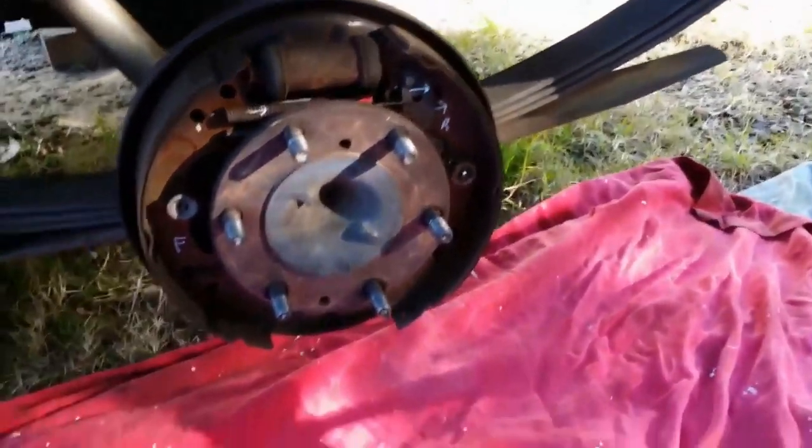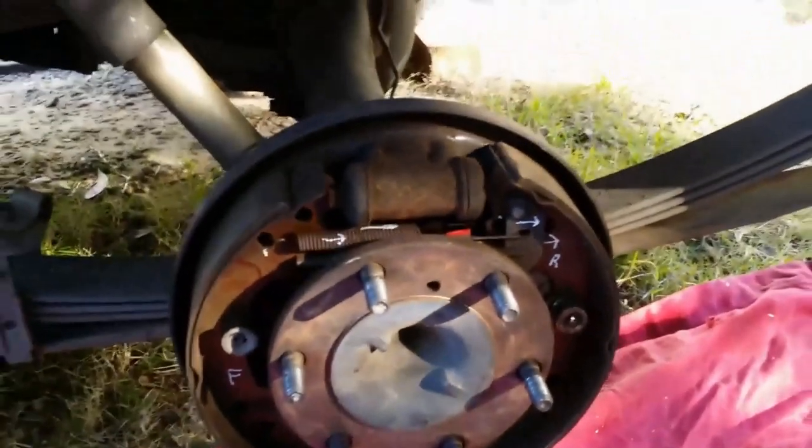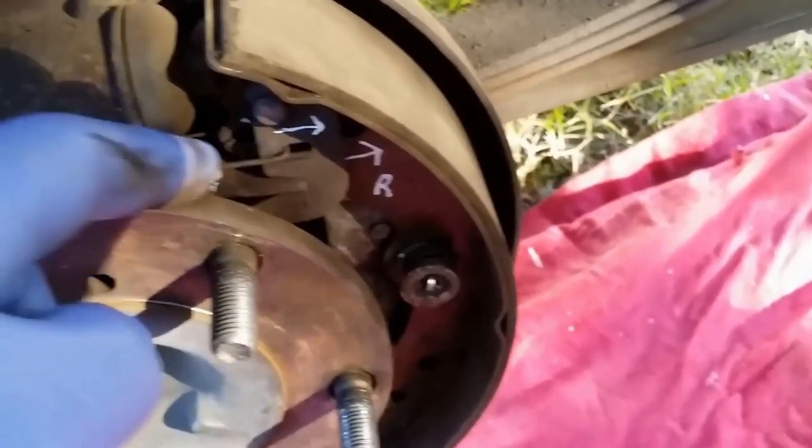It's not actually as complicated as it looks. You've got two shoes — these pins hold the shoes in place, you just push them in and twist them to unlock them. You've got two springs on top, one there and one behind, and you've got this spacer that's got an automatic tension device on it. That arm goes in and this spacer has a notched-out section that just ratchets and tightens the other spacer as needed.